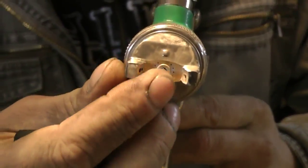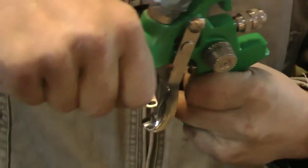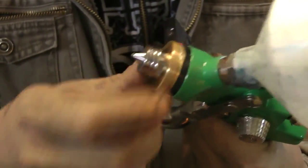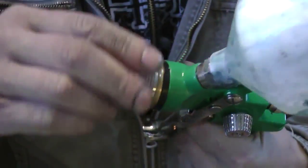For a start, I would recommend beginners to start with such a spray gun. How can you determine if a China-made spray gun is good quality? Chinese manufacturers have this differentiation: typically poor Chinese quality and not so much. This one is fine — it's not of typically poor Chinese quality. A spray gun which is more or less okay should look nice to an extent, everything should be tightened and neat. Undo the nozzle at the store and check if it has hollows or scratches. The nozzle should be in decent shape, and the orifice should not be oval.